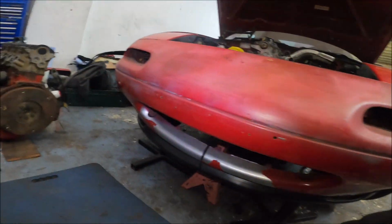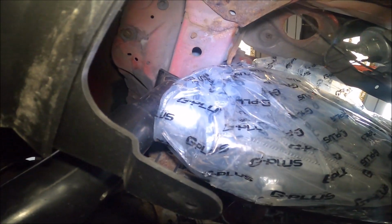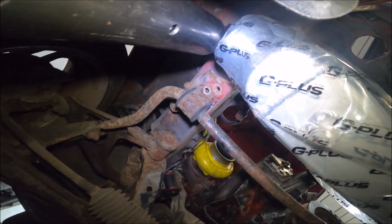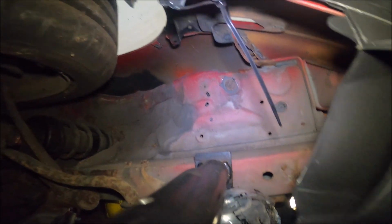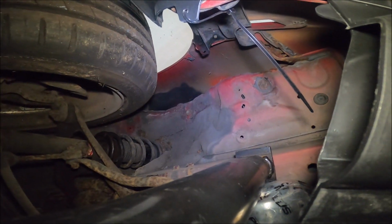And if we have a look from underneath, the intercooler pipes, obviously the jack stands are hiding it a bit, but they're either side there, which means there's room for it to snake around the anti-roll bar and then up either side to the turbo and to the inlet. Looks like it should work. I could potentially even come up there. Either way, there's plenty of room without the intercooler pipes hitting the wheels or anything, or suspension. So yeah, that was quite easy.